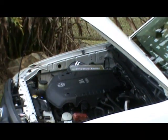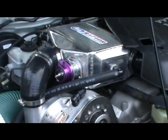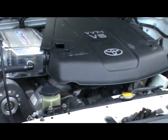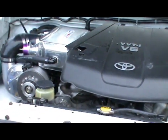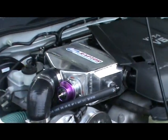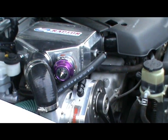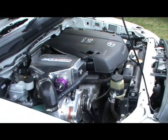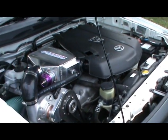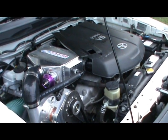Could there be something suspicious? There's an intercooled supercharger system by Raptor Superchargers. This 175 kilowatt vehicle is now 270, with 4 pounds of intercooled Raptor Boost. Simple modular unit, bolts on in no time at all. Allow yourself one and a half hours to install this system. Everything comes pre-bolted together with just a few bits to connect to the engine. Runs off the original engine belt, and it's upgradable endlessly — with up to another 150 horsepower above this particular kit available.